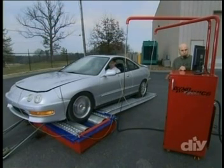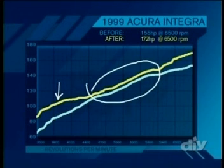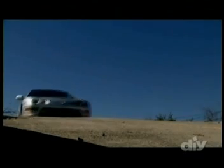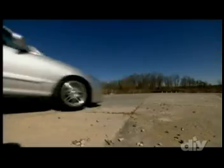After a couple of runs, it's clear that the new intake and fuel system are improving the situation. We saw a big gain of about 20 horsepower under 4,000 RPM, but then lost about 10 of that between 4,500 and 6,000 RPM due to the power-robbing automatic transmission. At the top end, our peak horsepower saw a modest bump from 155 to 172 at 6,500 RPM. It'll take some more work to bring the high RPM range to the point where the new intake and fuel system will truly shine, but the increased low-end torque will make the car more fun to drive and an overall gain of 17 horsepower is nothing to sneeze at.